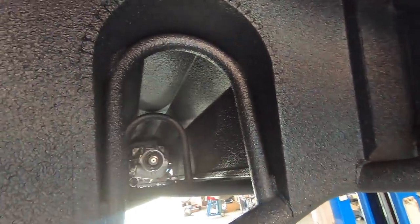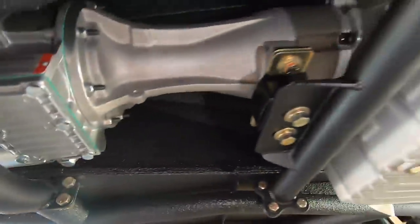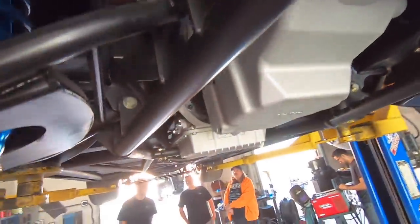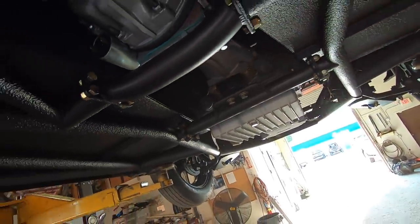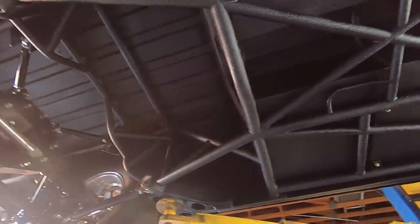There are multiple driveshaft loops, the Gear Vendor overdrive unit attached to the powerglide, the powerglide attached to the mid-plate, the mid-plate attached to the 427 LS, and a motor plate up front — an absolute unit. When you want to drop the transmission, you just unbolt four flanges on both sides. It all comes out as one big unit, and it's all SFI approved. Pro Fab did their homework.